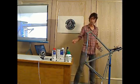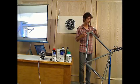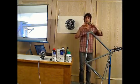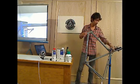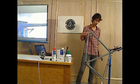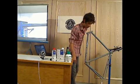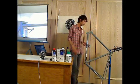When you start off with the bare metal, along with cleaning and prepping, another part of it is masking all these areas that you don't want paint on. I use a powder coating tape, one of those high temperature rating powder coating tapes. It cuts really nicely in the vinyl plotter. So we have these stencils laid out, where they're the right size, little bands go around for this, for that. I just cover the whole thing because I don't want to bother trying to paint these. I tried to before, and that didn't go over too well. So I was just like, no, I'm just going to do an oval there. That's what happens there, and then in the dropouts, wherever else you don't want paint, little plugs or tape on the inside of any of these areas, and that's it.